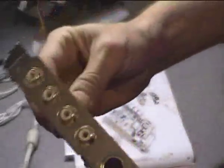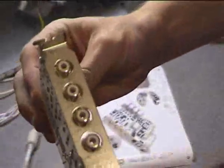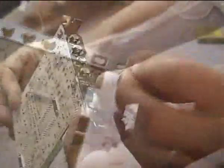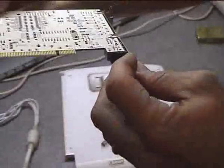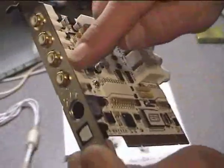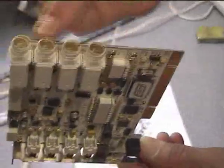As you can see, these are gold plated RCA connectors, you've got in left, out left and right, and you've got your little multi-pin connector there which connects the cluster cable for the SPDIF, isn't it? Yeah, it's got optical out as well, if you wanted to use a cable for that. Now, as I said, you've got RCA sockets on this side of the card, but weirdly, on this side of the card, again they're plated with gold inside, you've got quarter-inch sockets.